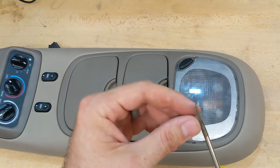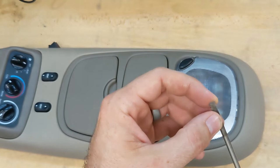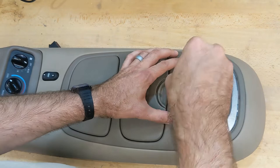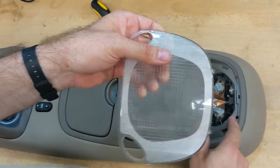To get these lights out I have a screwdriver that I use for prying - it's got a bent tip and I sharpened it a little bit so I can get in cracks better, but you don't have to have something like that. You want to attack it from this side because this side has pieces of plastic that go into the unit and you won't be able to click it out - you have to click it out from this side. I just kind of pry it, see how these little nubs go into these holes.